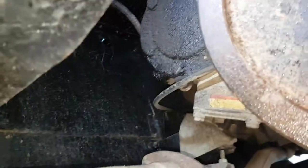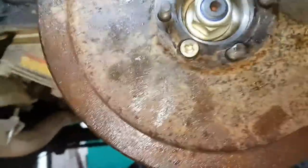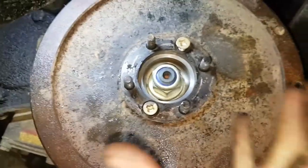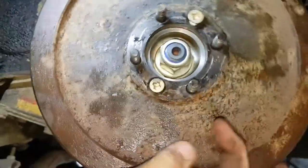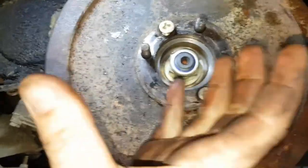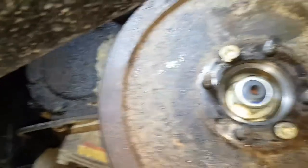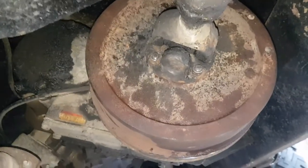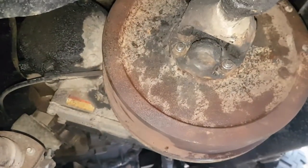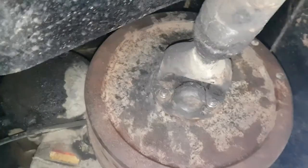Quick test on the handbrake. Now I've put the drum on and it will be very slightly catching. What you've got to do is very gently — I mean gently — with a hammer, shock it into going home correctly. Basically doing that all round and it should settle in. When that's done, tighten them up and that's it. Obviously you've got to adjust the handbrake but I won't do that off camera. My legs are actually drenched. Basically that's a nice little job out of the way. What a pig that is.